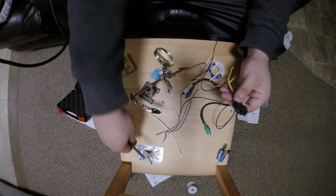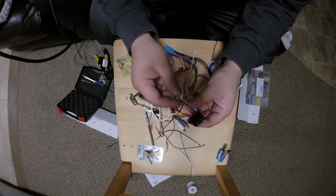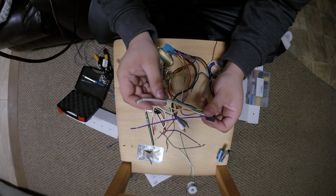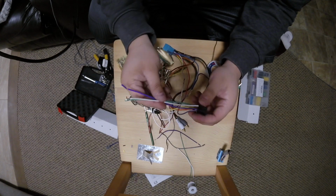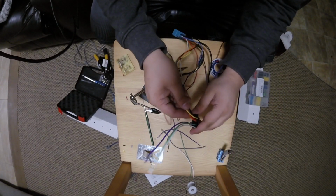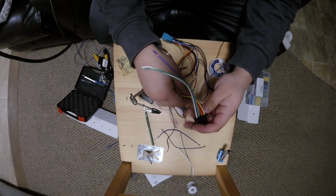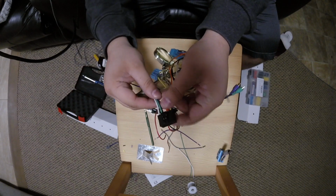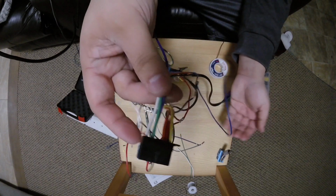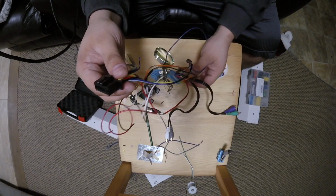So I'm sure some of you are wondering why I take those out and why I leave some in. I leave these in because your parking brake wire and then your reverse camera trigger sometimes come out of the radio, and you're not always sure what pin it is. Sometimes it's right here, sometimes it's one over, sometimes it's in that spot. So this gives them wires that they can easily move over or shift around, and they know that it's not a speaker wire because they don't have pairs. So I just leave that for the client so that they can do what they need to.